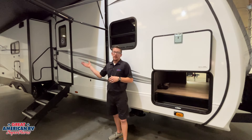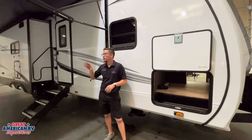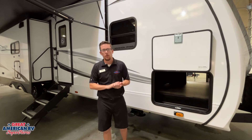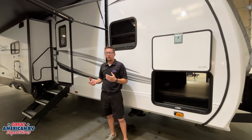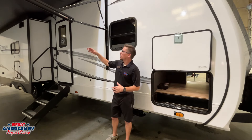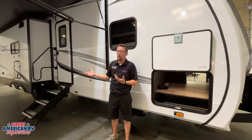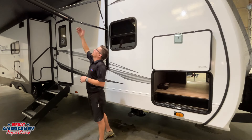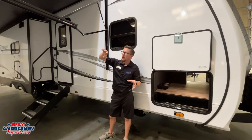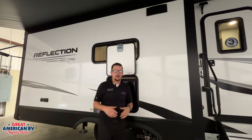The awning is mainly a sunshade — not intended to protect you from rain, wind, and all that. If you have heavy rain or a windstorm coming through, you need to roll that awning in. If you're leaving your campsite for an extended period, roll it in. When we do use our awning, we may get light dew, light rain, or AC condensation on it — it needs to drain off. We need to lower either the front or the rear awning arm. To pitch it, grab at the pivot point, pull down, and the awning arm tilts to let water drain out. To put it back, just push it up.